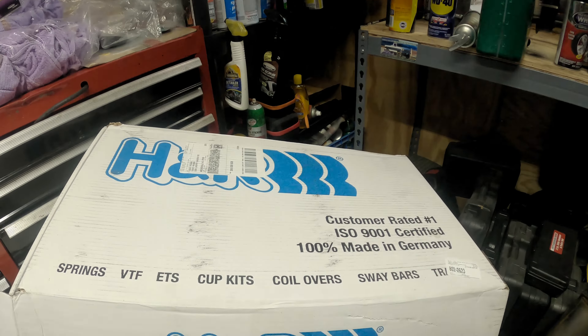But now the car is too tall — it just looks weird. I went with 17s which I think is a good size for the car, but at stock ride height they just look weird, like it needs to sit a little lower. So this led me to contemplating other issues, and where I wound up is with H&R lowering springs, new strut mounts, and new KYB struts. We're going to do all of this today, so let's get to it.